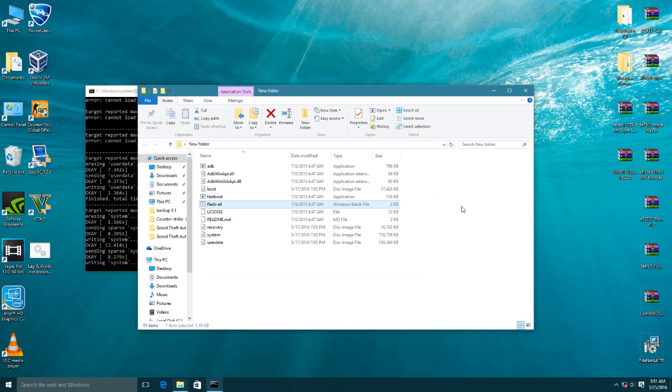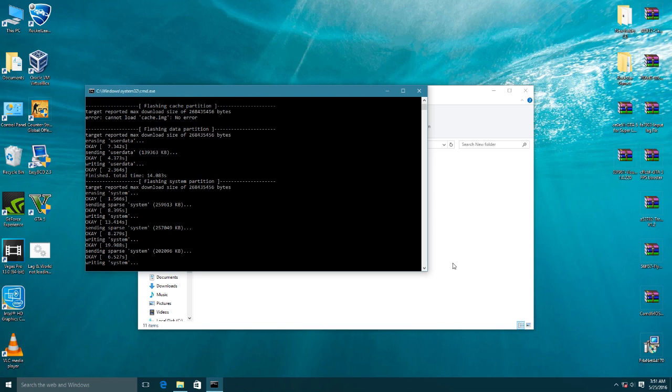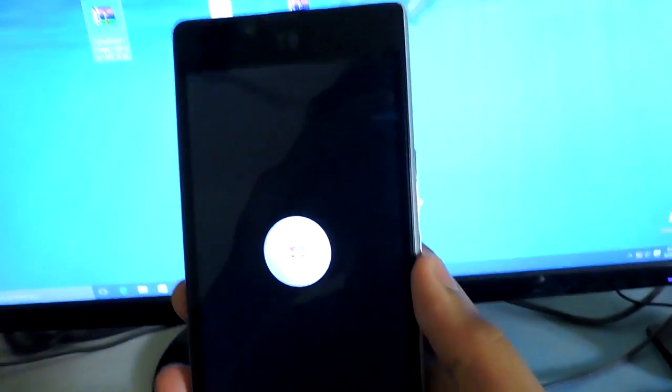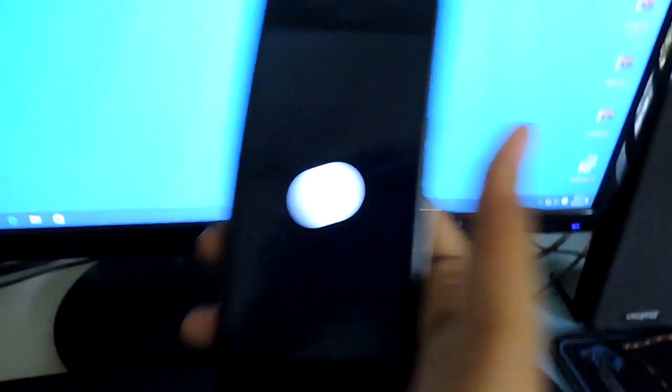I find this very easy compared to the official site instructions which have a very long ADB command description. Just wait till the process is done — flashing the whole system is a big thing. Also this ROM doesn't have a recovery — not stock recovery, CyanogenMod, or any custom recovery. If you need to install a recovery, follow the stock Lollipop method. You can see the new logo. Once flashing is done, unplug your Yu device — it will boot up quickly since there are no apps and no setup at all, going directly into the lock screen.